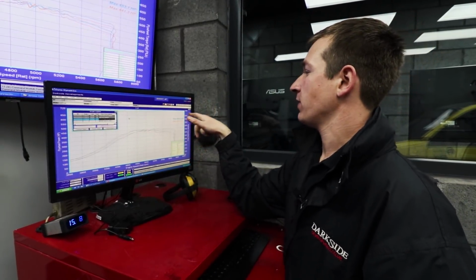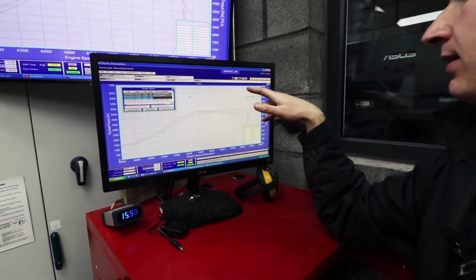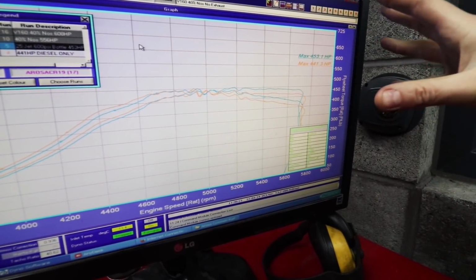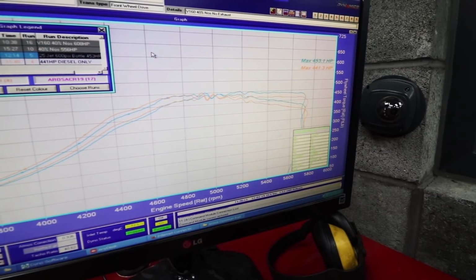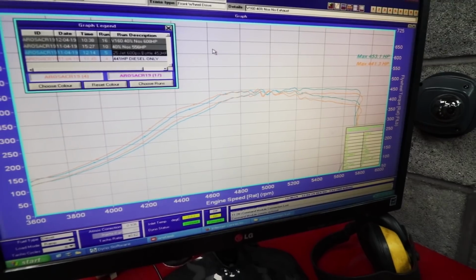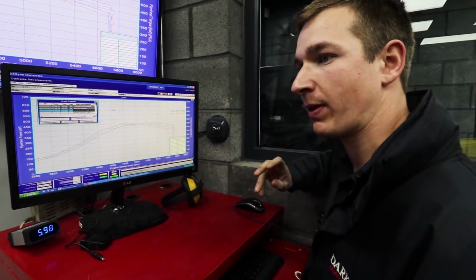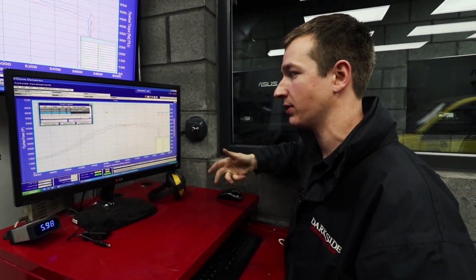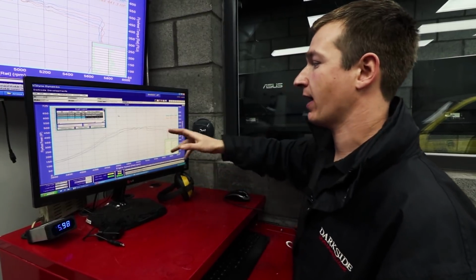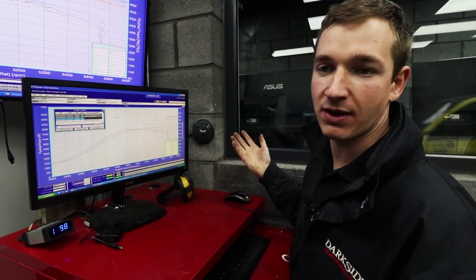So the 453 horsepower that you can see there, it's only slightly better. We'll go over to the car and have a look in a minute why we've got that, but that's with a tiny little bit of nitrous, just a tiny little jet. We use it just to bring it up onto launch control a bit quicker. We spent a bit too much time at the line trying to get it going, so we decided to put that on there. As soon as you go full throttle, you get a little bit of nitrous, and that helps. It gives a little bit at the top end as well, but we'd never run it like that anyway.